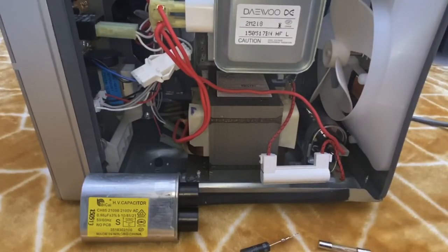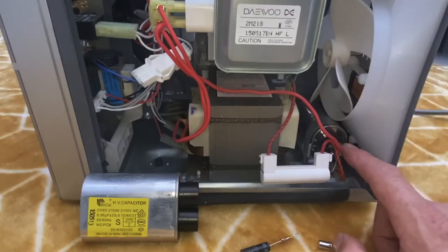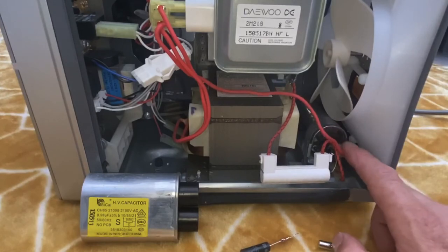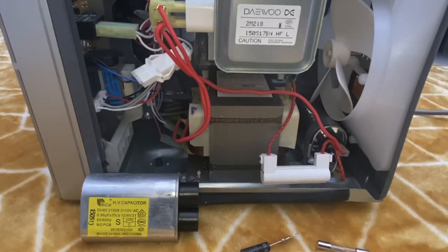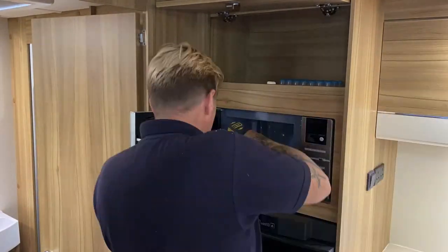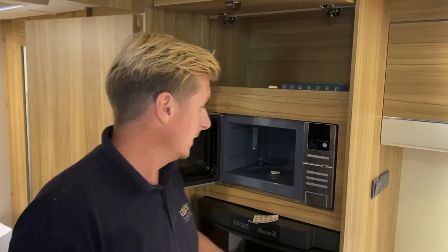If you're not entirely sure what you're doing, you really mustn't take this thing apart. The capacitor holds a lot of charge — even when it's unplugged it will still give you a zap, and we're talking between 3,000 and 10,000 volts. That will kill you. You've got to be super careful. When I replaced it I discharged it fully so it was safe to work on. I'm a qualified electrician and I wouldn't recommend anyone to normally do this. But yeah, pretty happy it's all fixed — happy days! Thanks for watching. If you like the video, please like and subscribe.